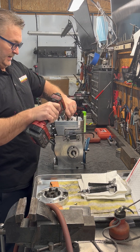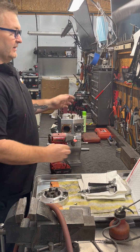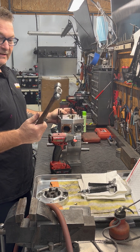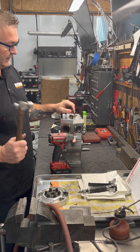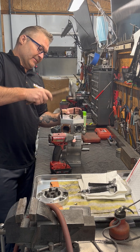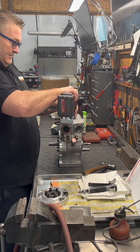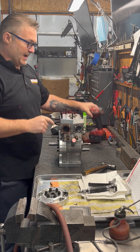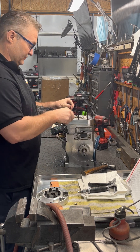So as you can see, I had one right here that didn't want to come out. Now this is a trick — one of our little secrets. You've got a head stud that wouldn't come out with the tool, so just take your hammer and give it a whack — not too hard. Once you whack it, it jars it enough to release it and out she comes.